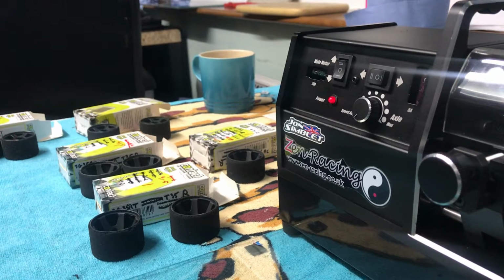so I know once they've set the ride height to be what I want it to be, I can put another set of tyres on to go out for the next run and it's the same. I will always check it, but it's nice to know that it'll be roughly the same, and I'm not going to have to worry about changing rollout and changing ride height and all of these things while I'm at the racetrack.